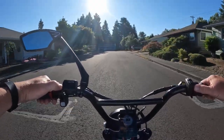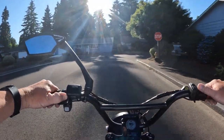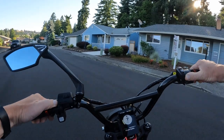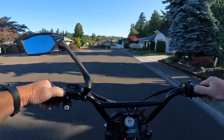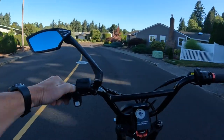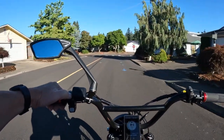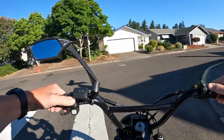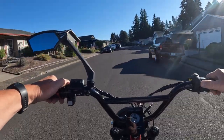I couldn't find anything on the torque for the bike, so I don't know what the torque is — it could be somewhere in the descriptions and I just missed it. The battery situation is a bit unusual: on the down tube it has one battery facing the front — a 20 amp-hour 52-volt — and a second battery underneath on the other side of the down tube that's an 8 amp-hour. That gives you 28 amp-hours total, which is not bad.